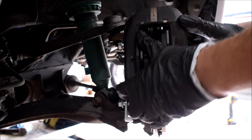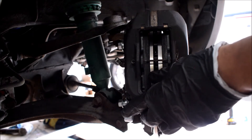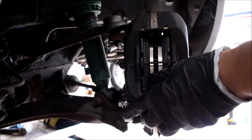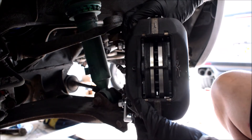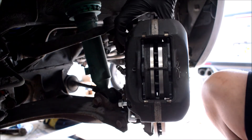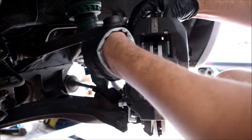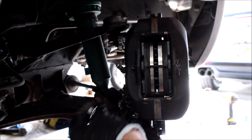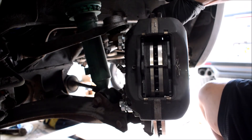It's a tight fit over the rotor. I think the Wilwood-branded pads are thicker than the old HP pads I used on my Tacoma — those seemed unusually thin for brand-new pads. With the caliper in place, swivel up the box mount bracket and put a bolt through, jiggling it a little to get alignment. Leave everything fairly loose. Do the same on the bottom. Four shims was probably a good call on this side as well — the alignment looks about right.